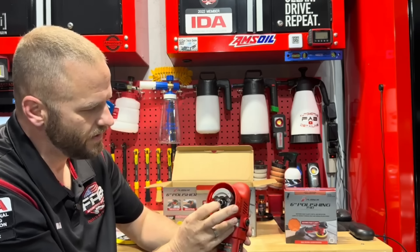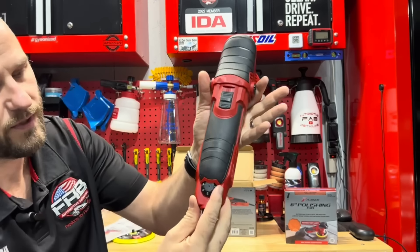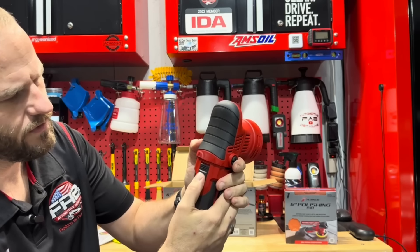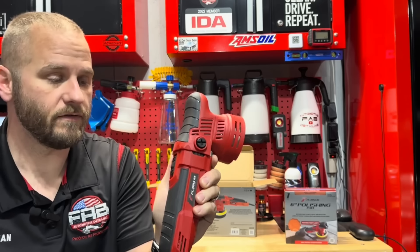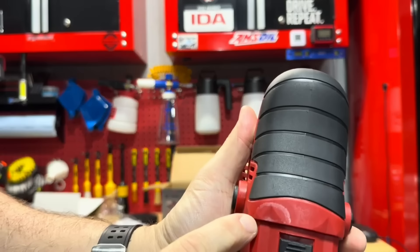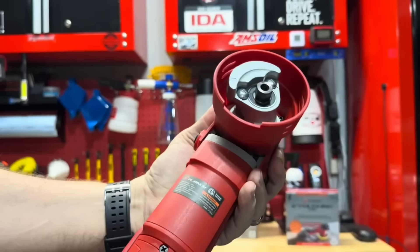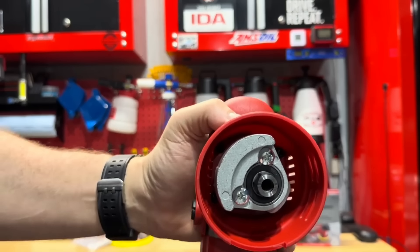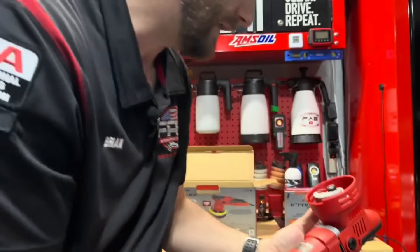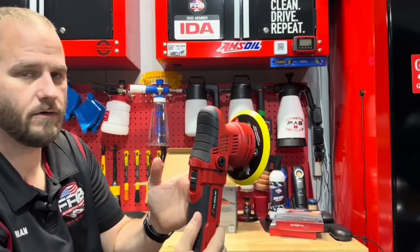The counterbalance is on there; it doesn't sound like there's a whole lot of grease in it, but we have to take the price into consideration. The speed dial has clicks, which I like — I hate the ones that are smooth. There is no momentary switch, so it's just on and off, which is great — you don't have to worry about holding a cruise control button like on other polishers I've used. It's made in China. The balance shaft is actually rather large. Overall it's not bad looking, and I bet it'd be easy to grease. I'm going to get the backing plate put on and show you what it looks like all the way together.